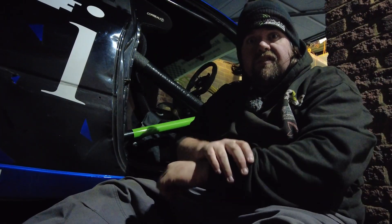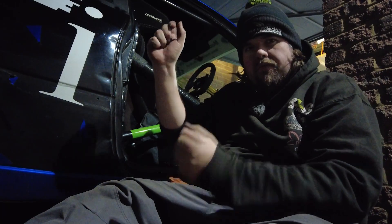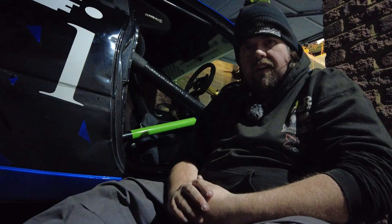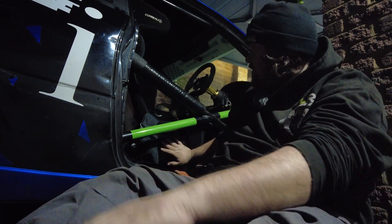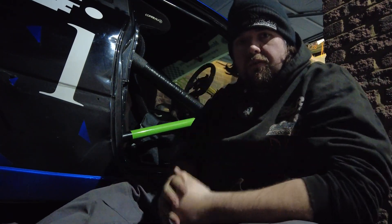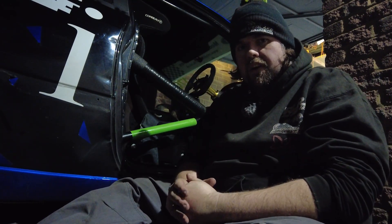The other thing I've been working on is driver ergonomics, working closely with Sam on that. We spent a bit of time sat in the car at Snetterton in the pit garage going through some bits. So I've done a load of work on moving this seat forward, probably about a good inch, inch and a half. The main reason is, if you look at a bit of an onboard here when I'm turning through a hairpin, I'm overreaching on the steering wheel - I'm stretching. That's no good because it probably helped contribute to the fact that at Brands last year, I did spin out instead of correcting the slide. It slows down your reactions. So especially with opposite lock, you need to have as much sorted out with the driver ergonomics as possible. I've moved the seat forward. The other thing is the steering column - because I've got this big extension on it, it sits up quite high. So I'm going to just unbolt where it mounts onto the crossbar and put a couple of spacer washers in to bring it down a little bit - only a millimetre or two.